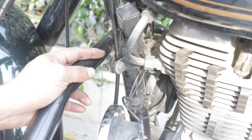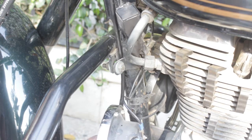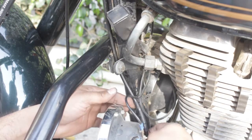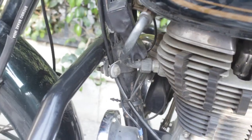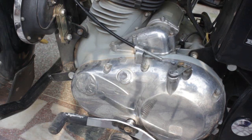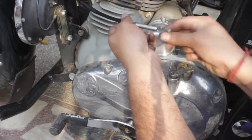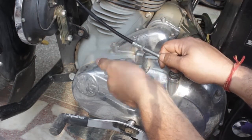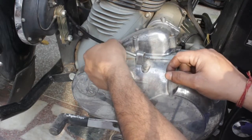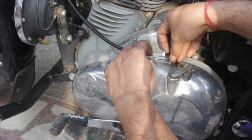Try to create a route for the cable in such a way that it is not rubbing into anything. Once you have brought the cable to this point, first slide in the first nut and then screw it in. Then slide it in here like this, then take the second nut and put it in here.